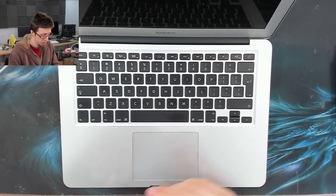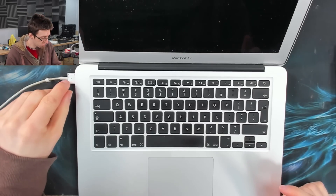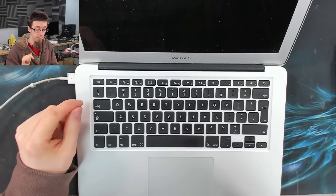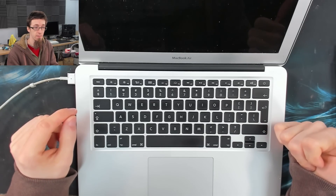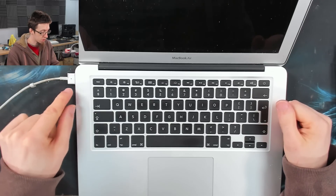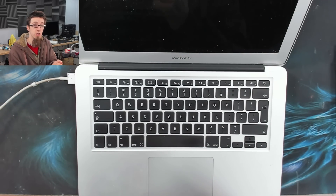Welcome to Let's Fix Computers. I've got a MacBook Air here that has no power at all — no light on the charger, press the power button, nothing happens, it's stone dead. With no light on the charger, we need pp3v42, which is the first power rail to switch on. We need the SMC to switch on from pp3v42, then it talks to the green light via the one-wire circuit. No green light tells me that's not happening — either one-wire, the SMC, or pp3v42 is not working.